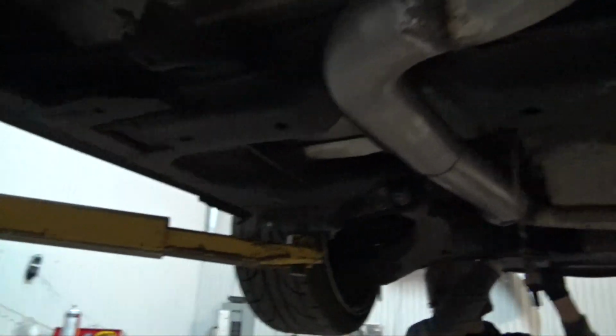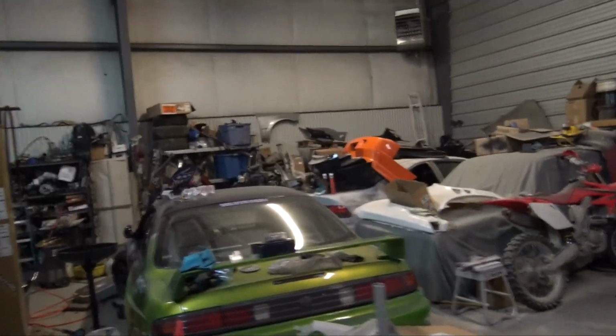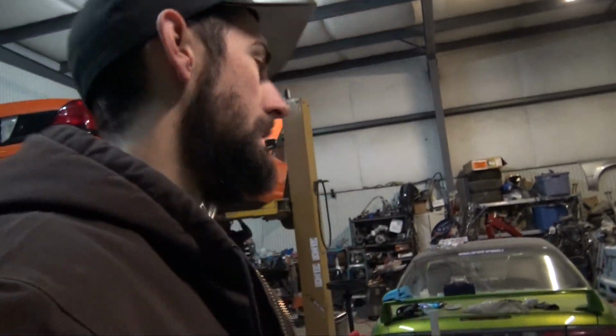We're probably gonna tap into the valve cover and have it dump back in there, maybe through one of the factory PCV vents, or the vent that goes from the intake pipe to the valve cover, because we ain't gonna be using that anymore on account of the intercooler piping. So we can't pressurize the crankcase.